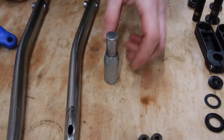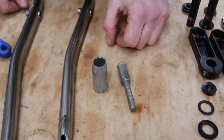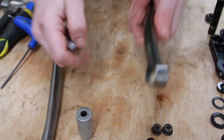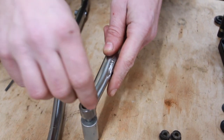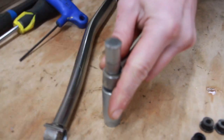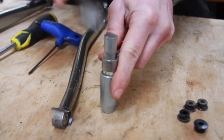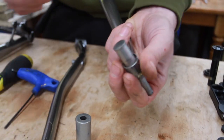To get the actual bushing out, it's dead easy. Just use a bushing removal tool — you get them for shocks and everything else, just the same job. Actually flip it upside down; it's got a flatter surface that sits on that edge. Line it up nicely and get it moving.